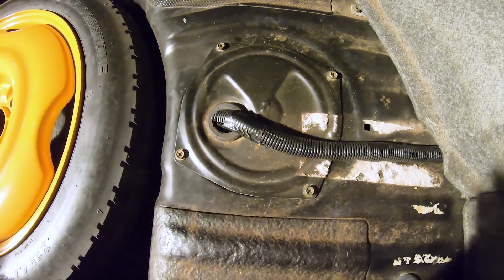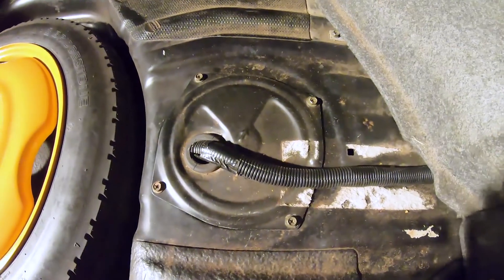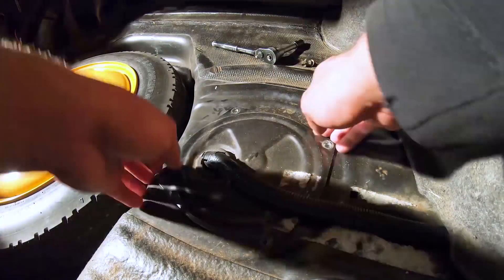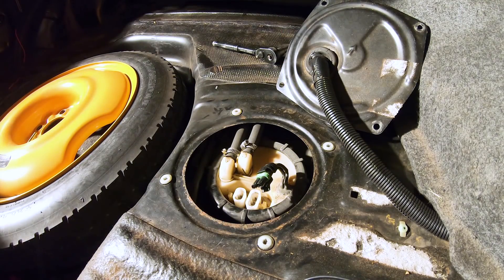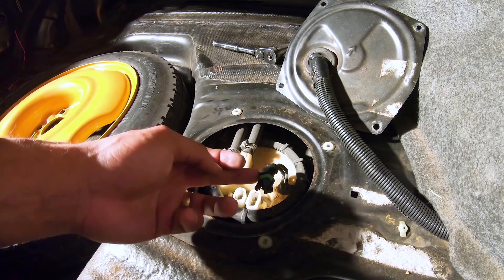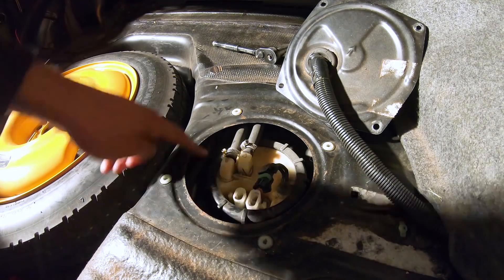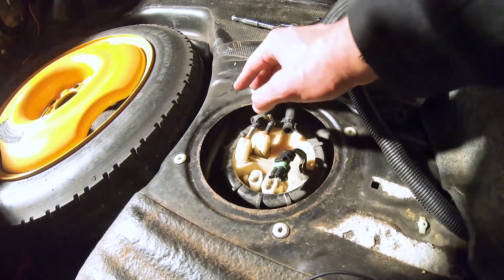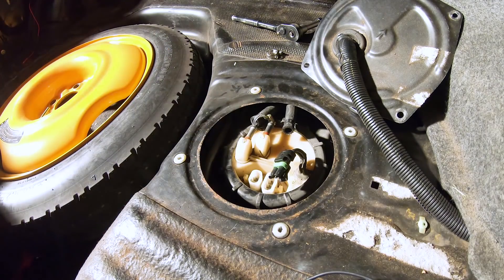There's your fuel hat - four screws to undo and then I get access, then I twist off the top. These are the new power wires for my fuel pumps, both sending fuel, and the return line is in there too. Two more bolts to take those lines off and then we unscrew the hat. And that is a cut from this thing - now I'm gonna need tetanus.